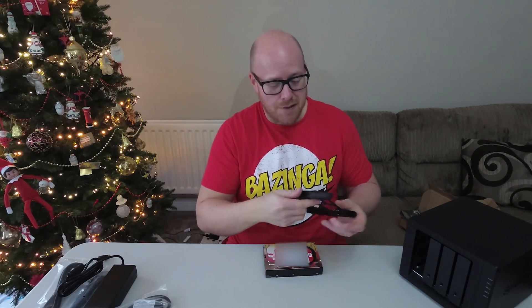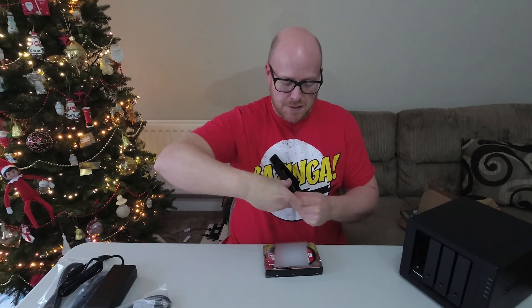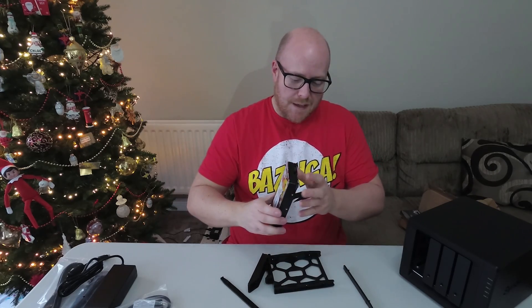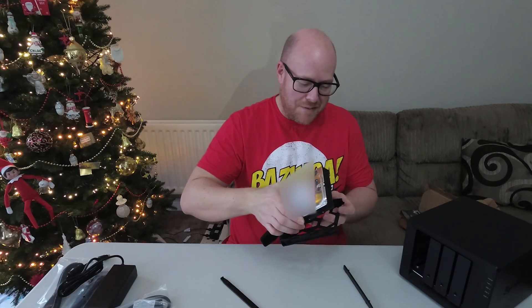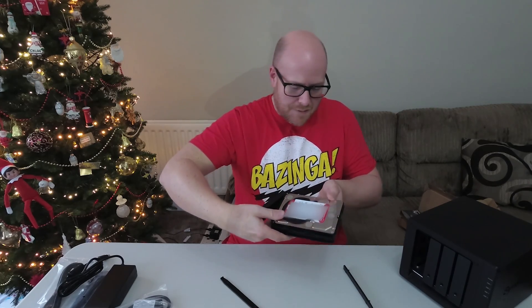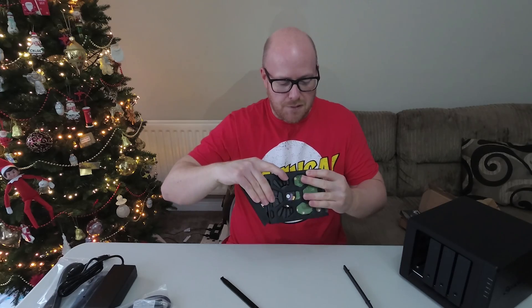Okay, so we're here for the other part of the video. I've had a quick look at the instructions — actually, no tools are involved. For the 3.5-inch drives you require no screws; you'd only need screws for smaller drives. On the drive caddy bay, you just pull off one side, then pull off the other side. The drive goes in with the SATA and power connections going toward the back — it's a snug fit, going nicely against the rubber grommets.